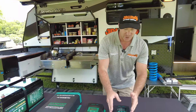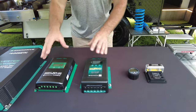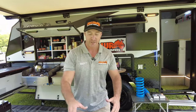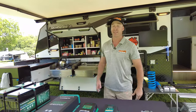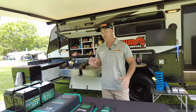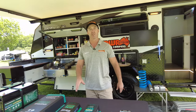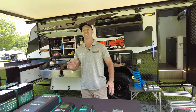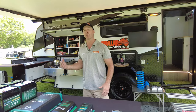Over here we've got our Enerdrive DC-to-DC charger, which also has a solar input. So this can regulate that 600 watts, and if you bring along some portable panels, this can take care of the rest of that. You could potentially plug in another 600 watts of portable panels, maximising it up to 1,200 watts going into your van. Running that aircon will be a breeze on a beautiful day. The input of these two will take care of that aircon, but note that the aircon will pull about 60 amps when running, so do be mindful of watching what you're putting in versus what you're pulling out.